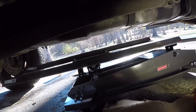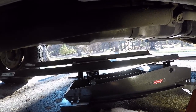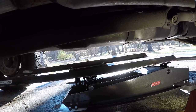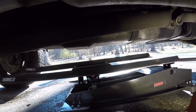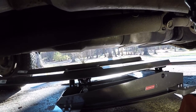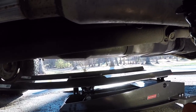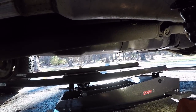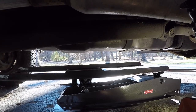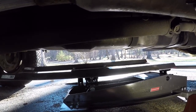That tank adapter came out pretty handy — that worked out really well. I'm disappointed that I can't drop the tank low enough to get it out from underneath the truck, but I should have seen that one coming. If you put the truck up on jack stands or on ramps — just support it really well, another six inches or so higher off the ground — you should be able to get it out from underneath the truck. If there's anything in my video you liked or found helpful, hit that like button and subscribe. Comment below if you have any tips or better ideas on how to make this repair, or if you know of a system to totally replace these plastic fuel lines between the tank and the fuel filter assembly on the frame. I'm all ears — thanks for watching.